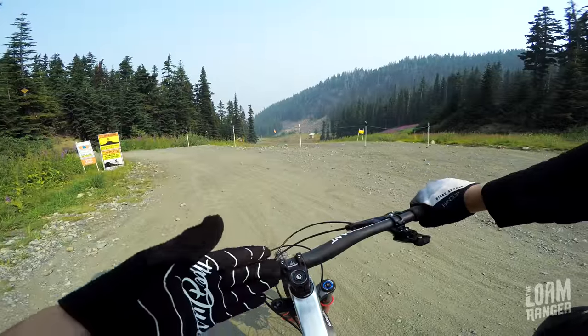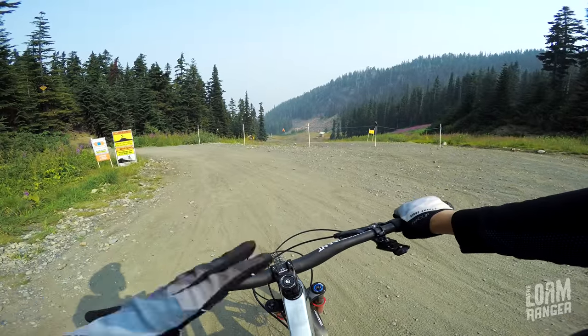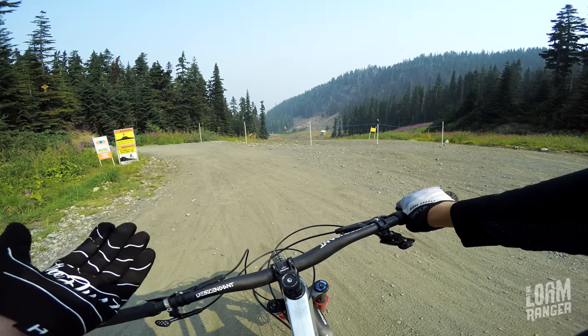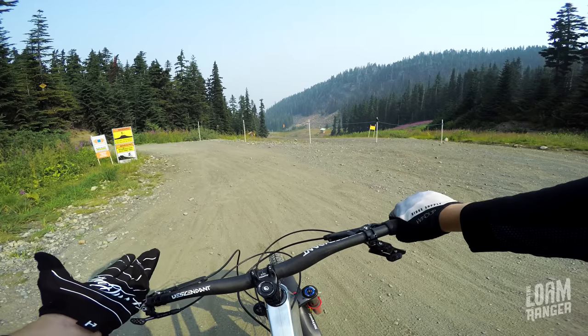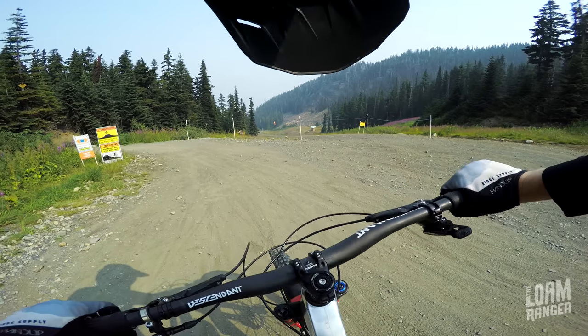They set the sag with seated sag, and then for front sag, it really just depends on feel. There's not a lot of point in setting a specific sag number. It's sort of like whatever works for you. You kind of start with the general recommendations from RockShox, and then Leo was saying you pretty much take it as high as you possibly can that's comfortable beyond that. Makes sense to me, nice and simple.